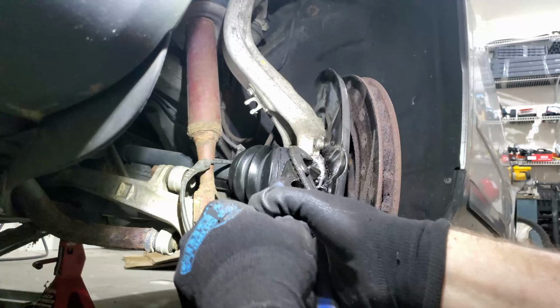Anyway, so what are we here for? Well, I wanted to show you inside here. That's the tone ring back there. That thing looks like all those little square cutouts. As those spin around, the sensor would just count the rotations. This is the bolt that was holding it in. That was in pretty bad shape on the outside here, but actually inside the threads look okay.